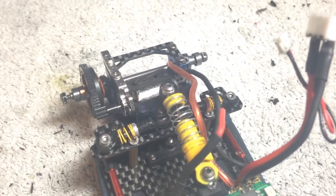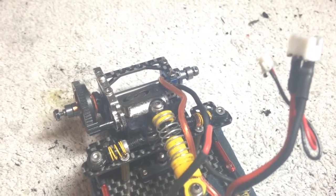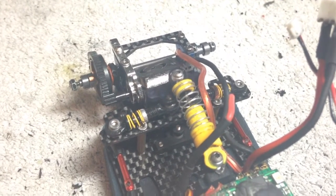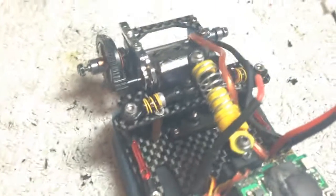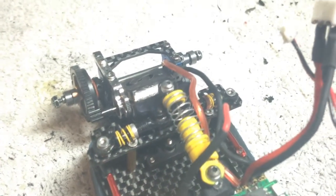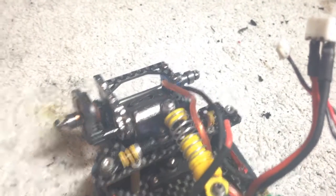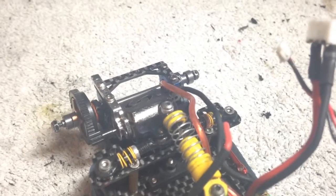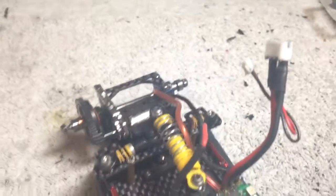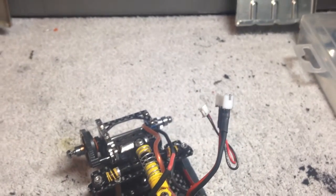the part of the oil where if you go stiffer, it makes it not have enough rotation. That really affects the late part of the turn, in the middle of the turn to exit, but it gives you more steering coming out because of the rear end sliding. And if you go softer, it's going to give you that rotation and more reactiveness. So in the initial part of the turn, you can say, "Oh, car feels good," but then you're going to feel the middle to exit of the turn pushing, so you're not going to be able to follow that tight line in those U-turns.